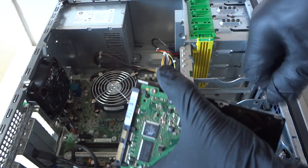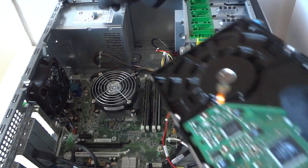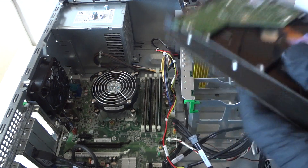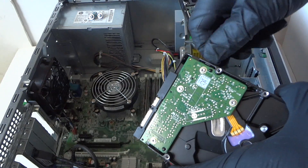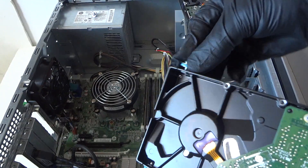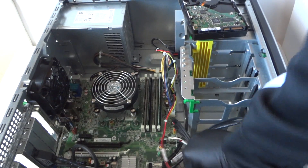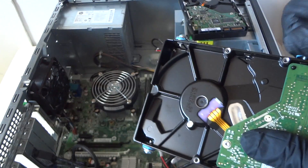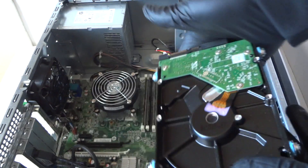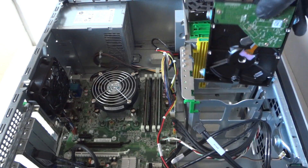We're going to the other side to remove the remaining screws and upgrade the hard drive — really easy, really quick. A screw fell off so I'm getting it back. This convertible mini tower works perfectly fine with Windows 10 64-bit with the Intel Core i7-2600 quad-core processor for light gaming. Here's the hard drive — reinstall the screws, reconnect it right back in here, and reconnect the SATA cable and power.